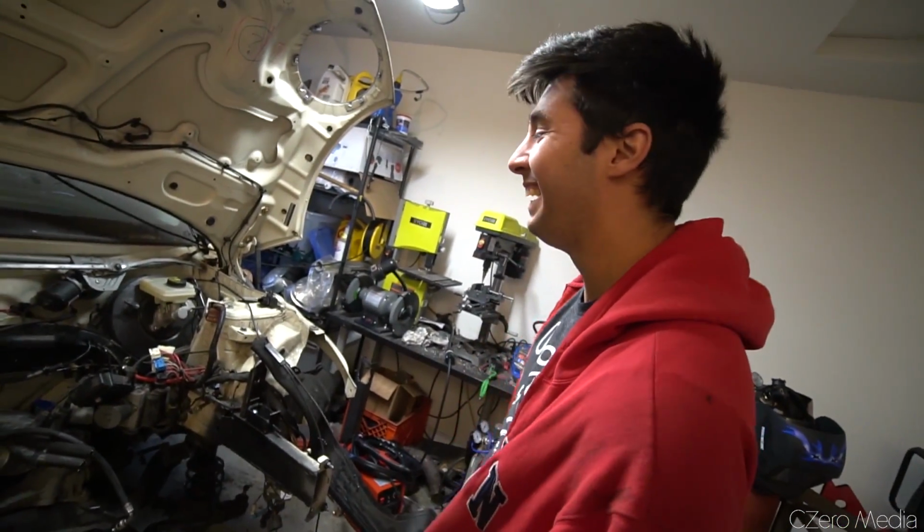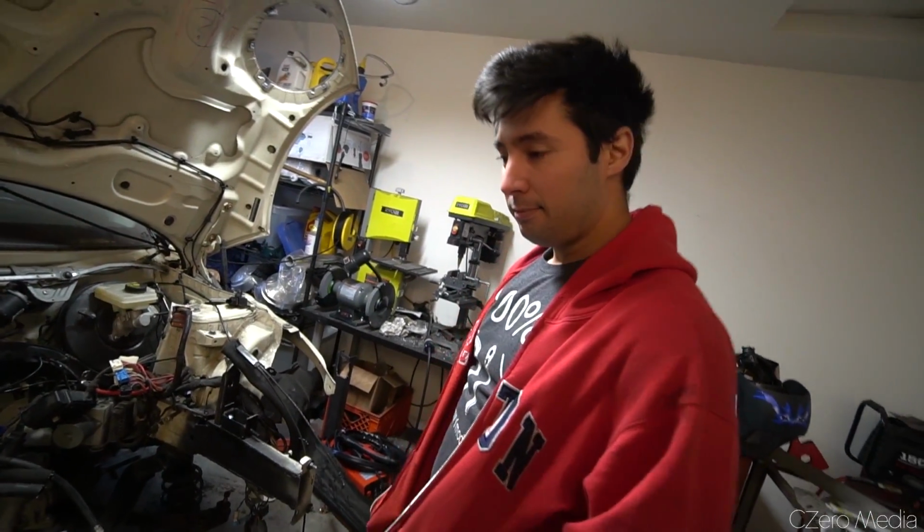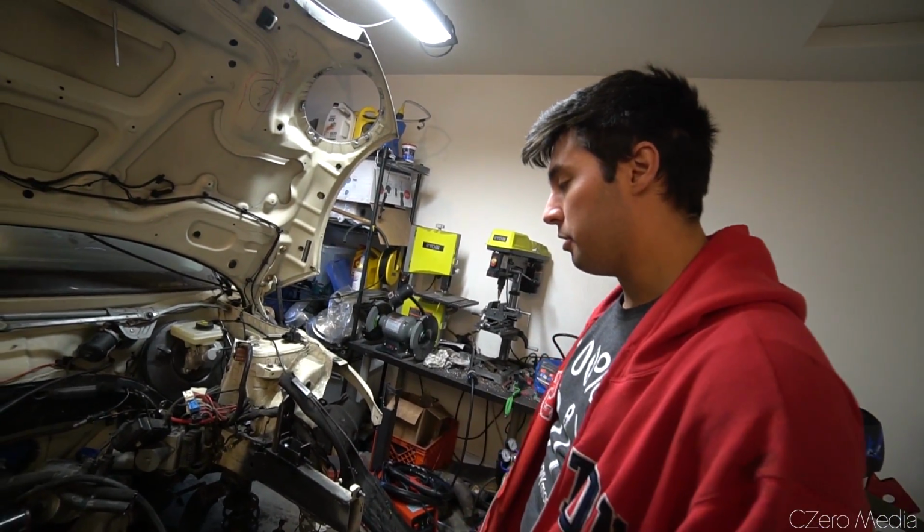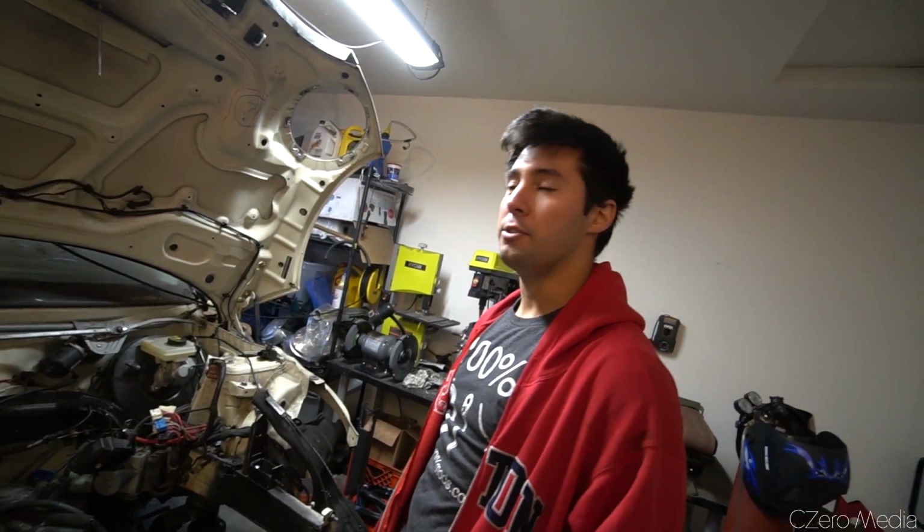Yeah, exactly. So what's your power target with this? Well, currently I'm limited by the factory injectors. It's got 450cc injectors, so I'd be guessing, though. What's the ideal? 300 to 350 at the wheels, and I think that'd be a fun limit to have. All-wheel drive, 2,700 pounds, should be pretty good power.